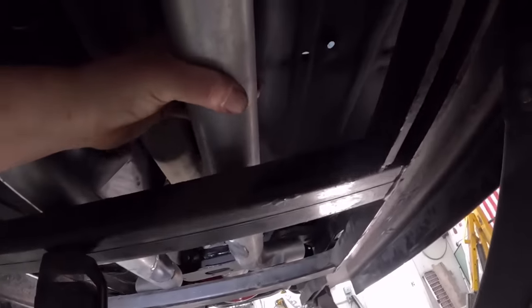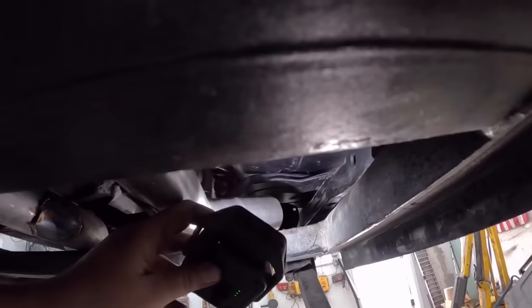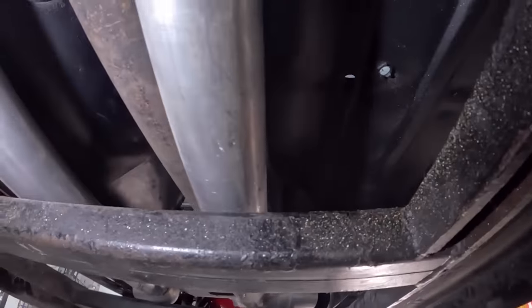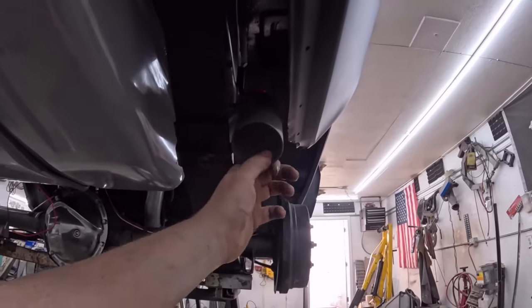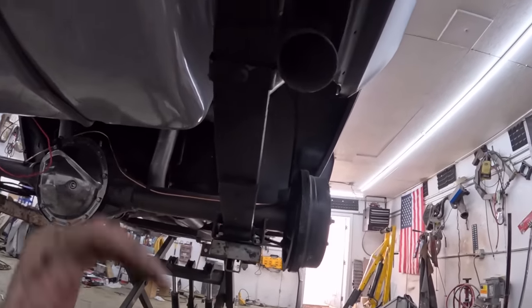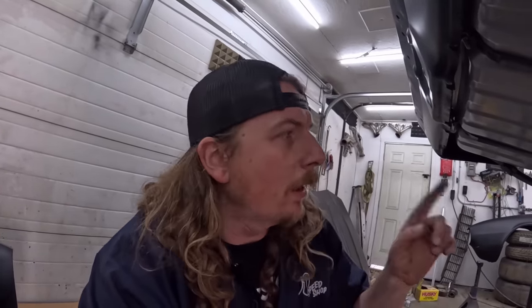And then up there, where that kicks out, you can see the hole of the collector. So we just have to join them. I'll be doing that from the front side. I hope it's pretty damn close, so I should be able to get that dialed. And then back here, this is all loose, but you can see it's almost right where we want, centered. It's touching the hanger, but everything is loose. So we give it a quick knock over and an impact, and this exhaust will be dialed. It's exciting stuff. I'll get this tightened up right quick.